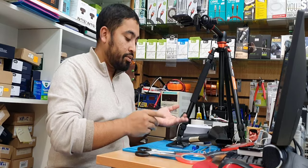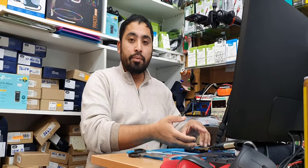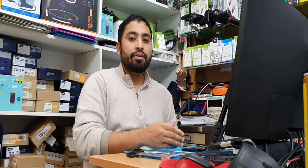First, you need to pull this out. When I opened the NFC port, I mean the wireless charging port, I took the front panel first and then the back. When I pull the back, I pull out the actual inside mid frame, because then I don't have to remove the glue tape and stuff like that. Follow step by step and do it.